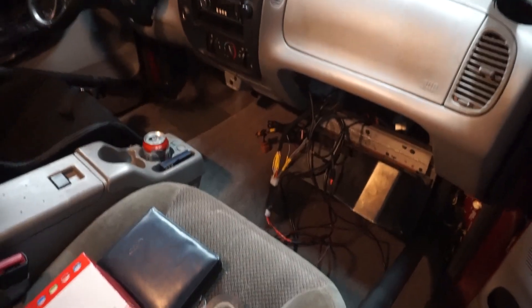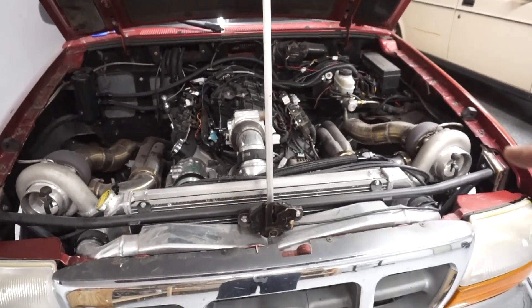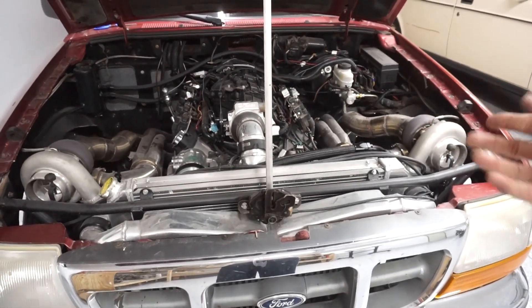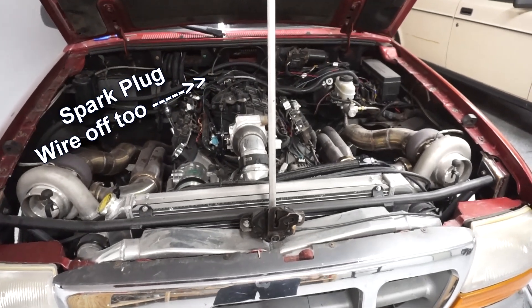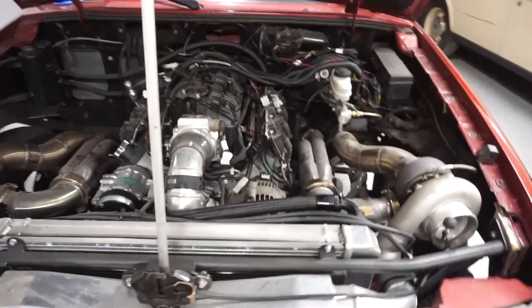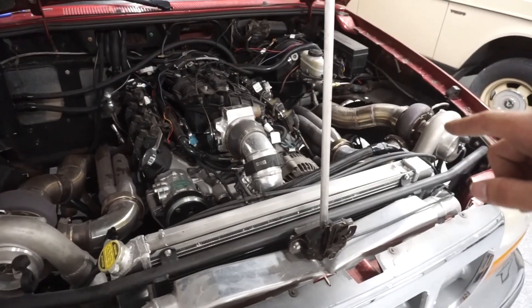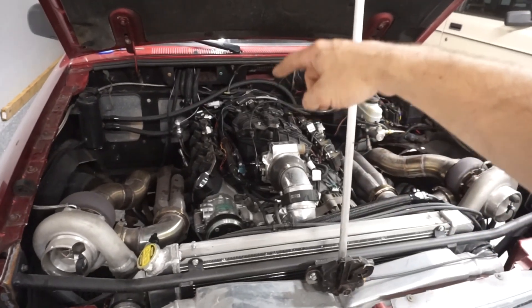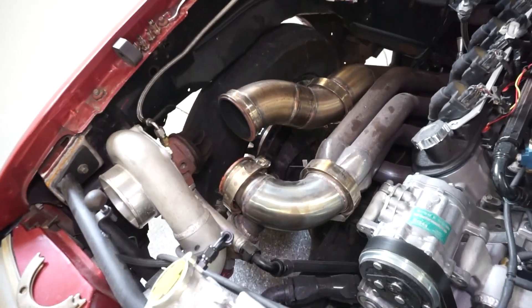We got solid green and you can see it charging at 14 volts, so basic function is working. It did start rough because the coolant temp sensor isn't hooked up — you can see a high error on the screen and it's not doing correct cold start fueling. But that's working for now. Next I'll figure out the temp sensor wiring — probably just going to cut them and splice in at the ECU.